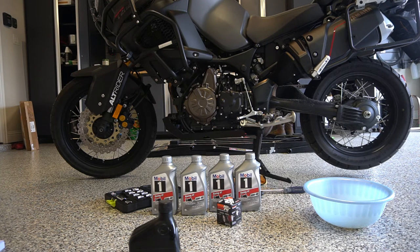And a lot of people think that you could just go to the store and buy the correct weight oil. Like, let's say in this case it's 80W90, and you could just throw it in your bike and they would have no problem. At least for me, I know on cars, it really affects your car greatly. So I have a 15 Escalade, and it's a truck without limited slip differential. And a lot of these oils and fluids on the shelf, you go to O'Reilly's or Walmart, they have limited slip differential additives. And actually, if you look on forums and YouTube complaints, if you put limited slip differential oil in a truck that doesn't need it, it can cause vibrations and unwanted noise in your differentials. And it goes for the Camaro too.